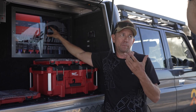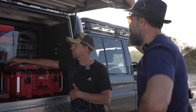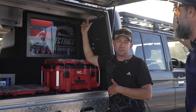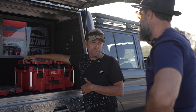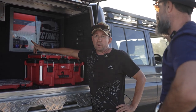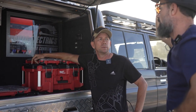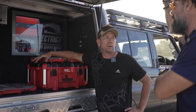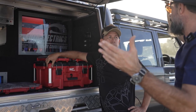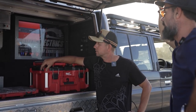The system also has a 240-volt input so I can charge from a power point at home — just plug in an extension cord. If I'm going on holidays leaving the car behind I can leave it on charge and keep my fridge running the whole time. There's also a 150-watt solar panel on the roof. The 150 watts will stay well and truly in front of the fridge — if you're just running the fridge and nothing crazy off the inverter it'll keep the fridge going no problem. Then turn the vehicle on, hit the idle-up button and you've got 130 amps going in — 20 minutes gives you another day or two easy.